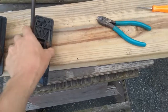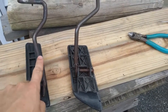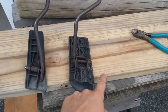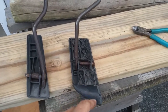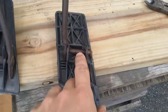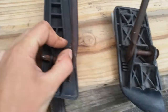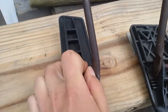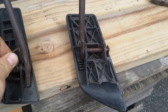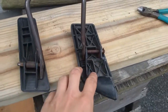The difference is, even though they look similar, the older model goes in from the driver's side, while the Chevy truck pedal goes in on the passenger side. The wagon uses the same bracket. What you need is the spring robbed from the Chevy truck pedal — it goes on the wrong side otherwise. If you can get the spring off the Chevy truck gas pedal, that's all you need to swap out.